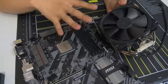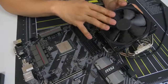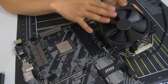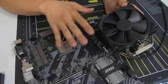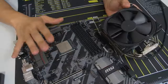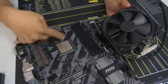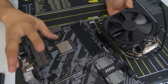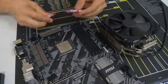This is where things get a little tricky because there's no standard method for installing CPU coolers — it all differs based on the manufacturer. This Noctua cooler installation will be vastly different than an NZXT cooler versus a Thermaltake cooler versus a Corsair cooler and so forth. So this is really the only part in the build where I'm going to have to leave you on your own. At this point, consult the manual that came with your air cooler or liquid cooler and follow it to a T. Make sure you're following the instructions that pertain to your particular socket.